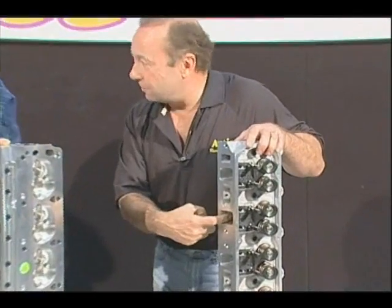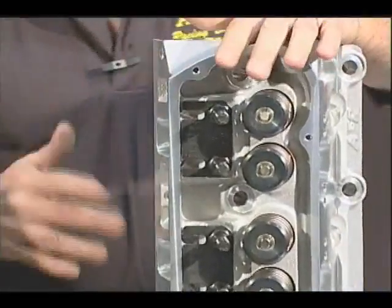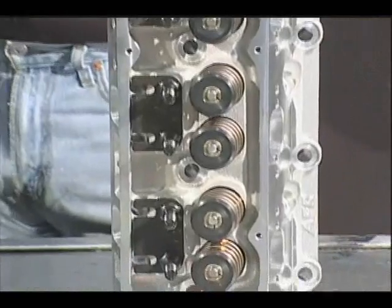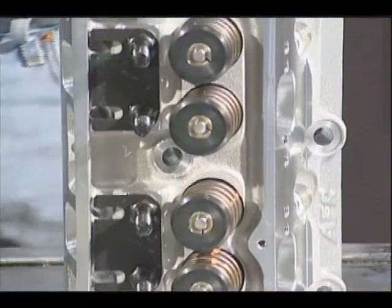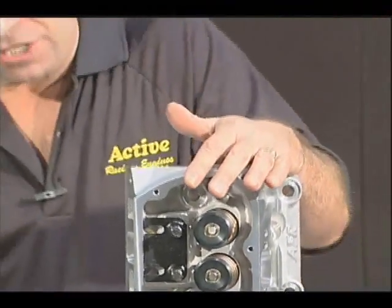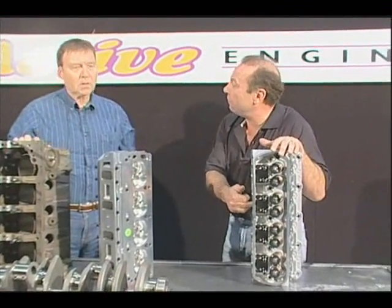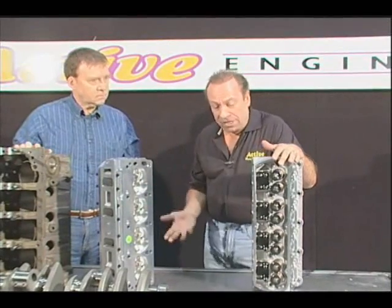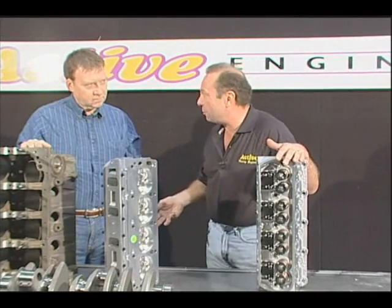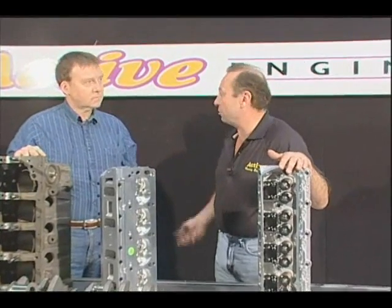As you can see by this particular port, we have a CNC-finished port and a CNC-finished combustion chamber — it's a beautiful head. But at the same time, there's a process we go through picking what head is correct for our application. In this particular engine build, we're using a 408 cubic inch motor in a very light car, so we decided to go with the AFR 227 CC head — that refers to the intake runner volume. As the intake volume increases, so do the flow numbers. But you have to be careful: if you're only running a very small cubic inch motor, you would choose a much smaller runner intake port, or else you'll give up a whole bunch of torque and throttle response.